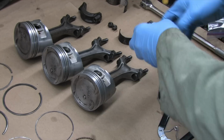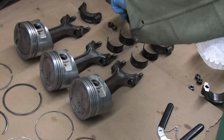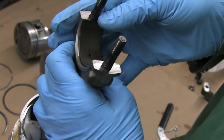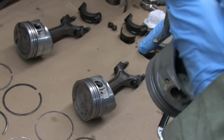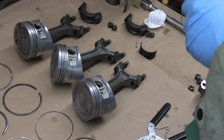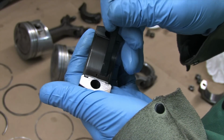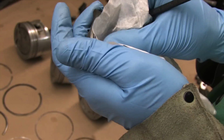You take your wide bearing and your tight bearing and you swap them. Most people find there's a little variation in thickness between most brand new bearings, at least enough to create an anomaly in your measurements. Frequently there's also a little bit of variation from one to the next, even in a freshly machined part. This can work against you or in your favor, but usually in your favor. It's always worth a shot if this happens in your measurements, because it helps you to put together a more uniform oil system. If one's looser than the rest, it will leak more oil, at least more than the rest. If it's really loose and out of shape, it will change how the oil film layer behaves on that bearing.